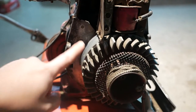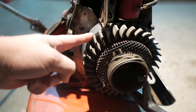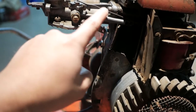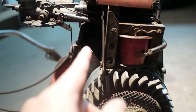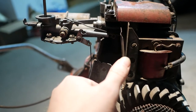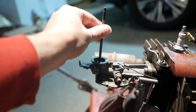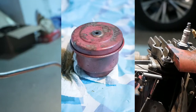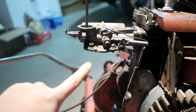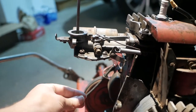Here's what I'm talking about. I took off the coil and underneath is where the point contacts were. One other thing I've done is replace the governor spring right here — you can see it adjusts right here, the governor leading back. That's essentially my throttle. And here's the carb — this is where the fuel filter pops up, and then the fuel tank goes down here and the fuel pickup line will connect down.